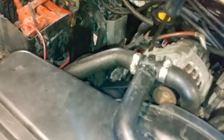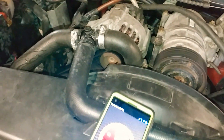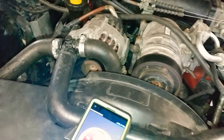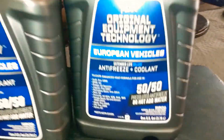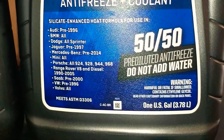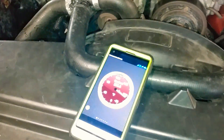I've got most of the air out of the system now, so I'm going to let it cool down, drain it, and add the right coolant. The reason I'm doing this flush is there's that orange stuff in here which is not suitable for this engine. This blue coolant is the correct one — it's for Range Rover V8s and diesels, 1990 to 2005, and this is a 2004.